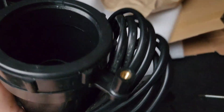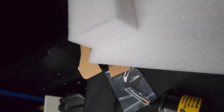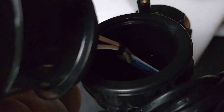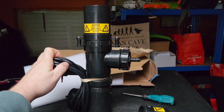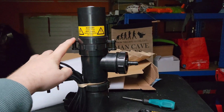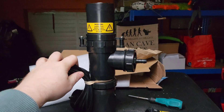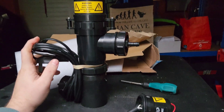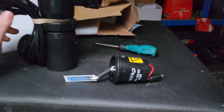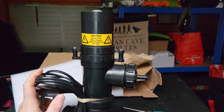You'll pop your discharge unit back into the port sleeve there and screw it all back up. There it is, all back together — two screws put back in, job done. Really simple. It's a two-minute job tops, nothing daunting or overwhelming at all. Obviously, make sure it's not plugged into the mains while you're doing it — safety at all times. Undo those two screws, pop out the unit, undo the cable, plug the new one in, pop it back in, screws in — job's a good one.